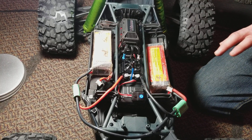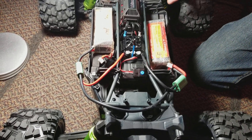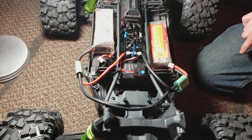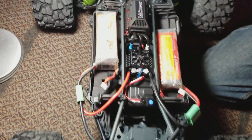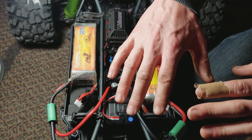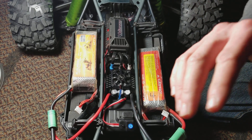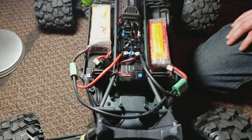There was a weird little glitch with the steering servo, but basically you have motor response and you have reverse. The thing with reverse on this speed control — on the bigger speed controls for larger RC vehicles — you have to come to a complete stop. It has to register that it's fully stopped for a couple of seconds before it'll go into reverse. So when you press reverse and it doesn't instantly engage, that is normal on a bigger speed control.